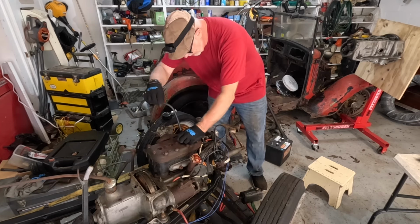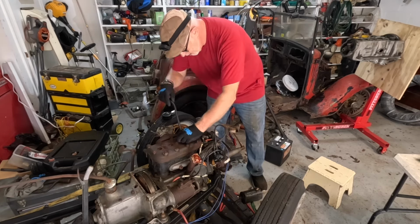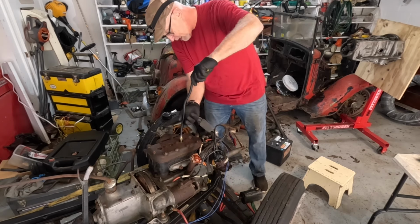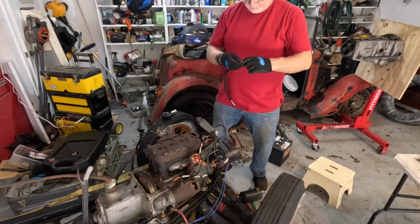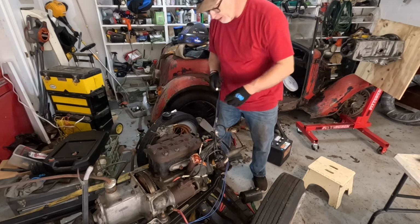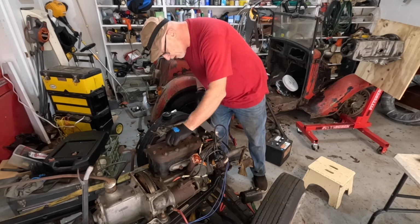Right, okay. So, let's get this one out now. It's hard work turning this old thing, I'll tell you that for absolutely nothing. So, 25 in the first one, 0 in the second one. Yeah. So this does confirm that. Best to take the head off.